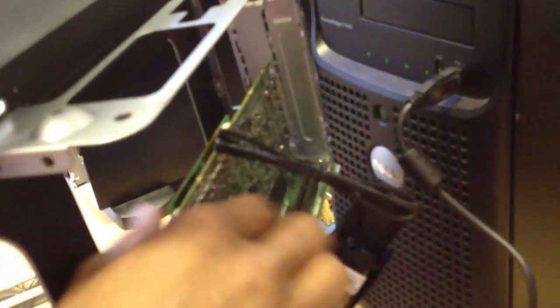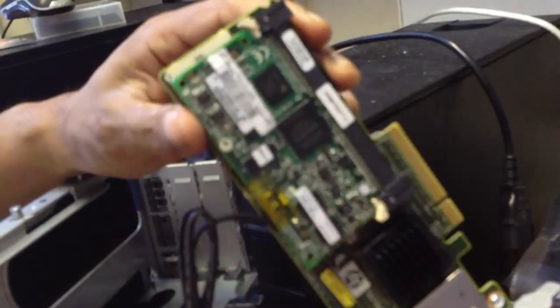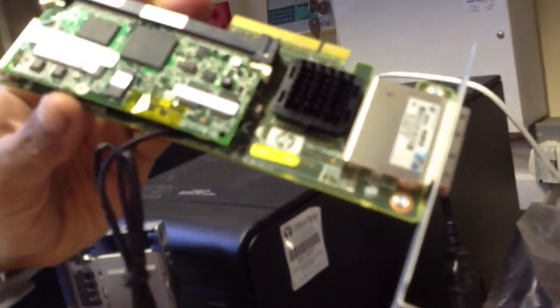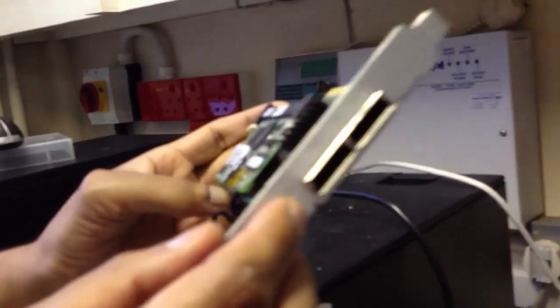I'll quickly show you the host bus controller, which is here. When you put it in — I'll take it out for you to see. If you take this thing out, then it can easily unhook the card. But be very careful because it has got RAM installed, so you don't want to damage that RAM. This is a PCI Express host bus controller. It comes with a battery module and it has got a cache module — it's RAM, so it caches all the data to improve the speed of writing. As you can see, it has got the same sort of interface. The part number here is 578229-B21.